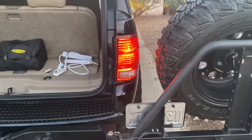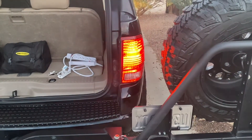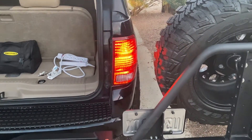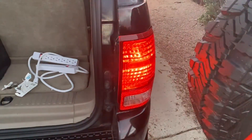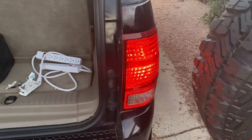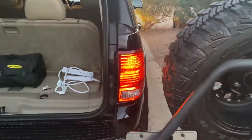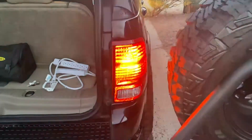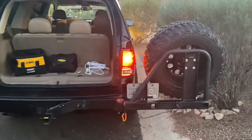You can see this side has the slower pace — I'm going to replace it since I have another bulb, to see if it changes to the quicker pace. If it does, that means those LEDs have a little different resistance and it tells the system the bulb is out. And that apparently is why those LEDs say off-road use only — it tells the system the bulb is out and makes them flash faster.